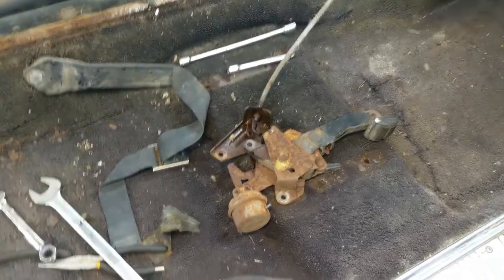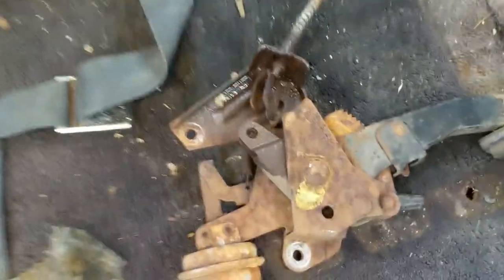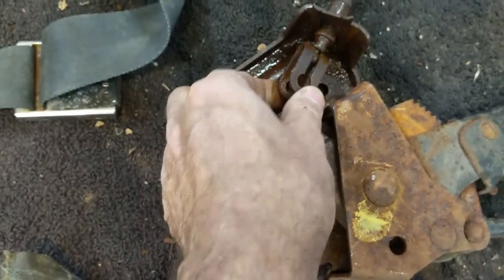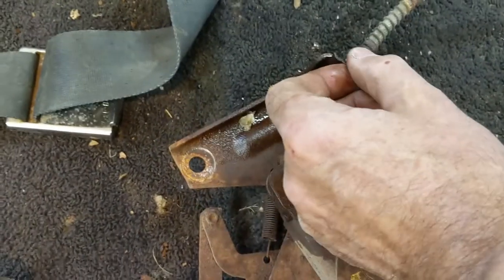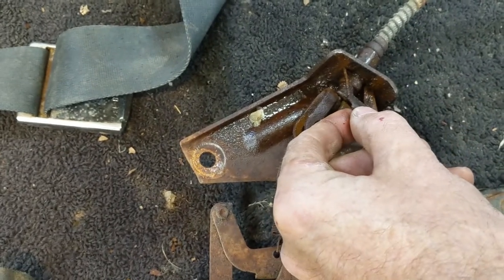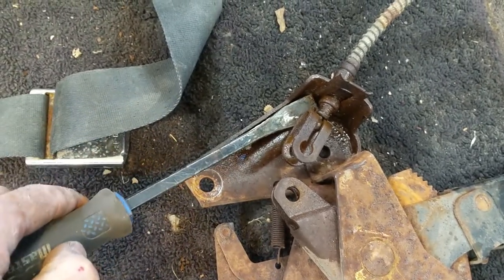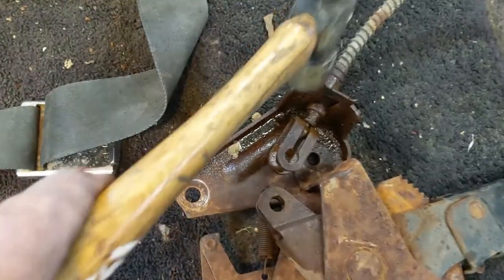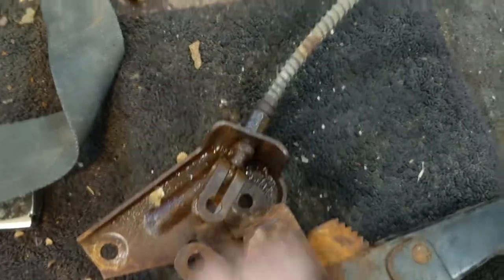Okay, one more thing I almost forgot was to deal with this brake assembly. So you saw me put the deep creep on to get the pin out for this U-bracket. And also here, so now I've got it sat for a bit while I was doing the other work. You pull that out. I ended up, just a little tip here, going underneath, if it's out on the ground like it is here, just going underneath the tabs and just tapping down on the frame with the ball peen hammer. And then it popped right up out of there.